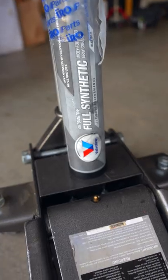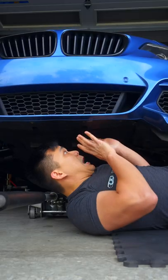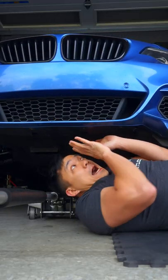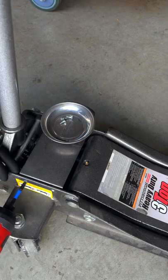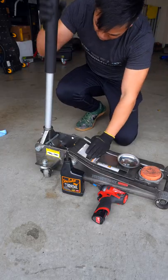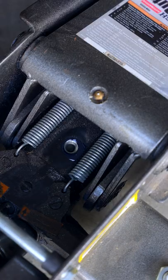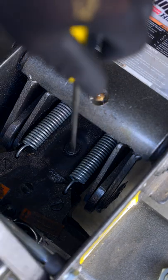In some cases, you may also have a grease fitting. If your jack starts to lose power, don't panic. Just bleed your jack by loosening the fill screw, opening the valve, and pump the jack quickly several times. Here you can see an air bubble come out, but leave your screw on to minimize the mess.